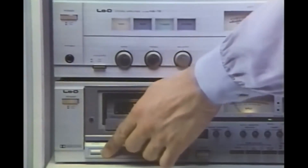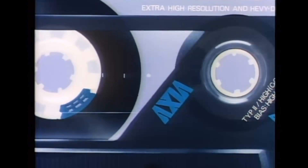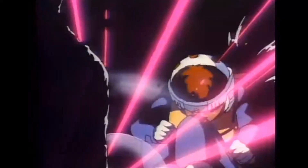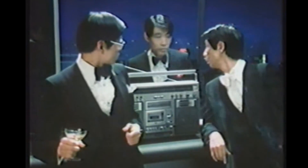I decided to make a video that could help as many people as possible by including different tape players like decks and Walkmans and three different budgets. One word of advice before diving into this: the speed and accuracy in belt-driven devices is strongly associated with the state of the rubber belt. It might be that your cassette player just needs a little calibration, but if you haven't changed the belt in a long time, or if you adjusted speed and after a few hours of playback it goes back to being faulty, then that's a clear sign of a much-needed belt replacement.